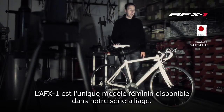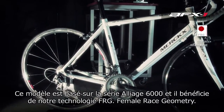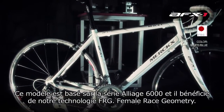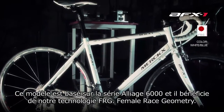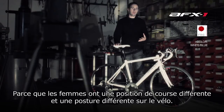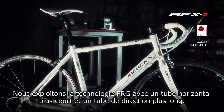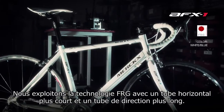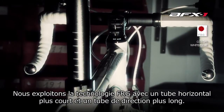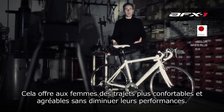Our AFX1 is the only female bike we have in our alloy range. It is built around 6000 series alloy and is using our FRG technology, female race geometry, because women require a different riding position and a different posture on the bike. We are using FRG in terms of a shorter top tube and a somewhat longer head tube. This gives women a more comfortable and more pleasurable ride without compromising for performance.